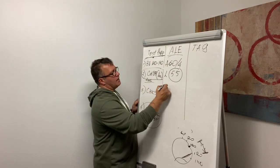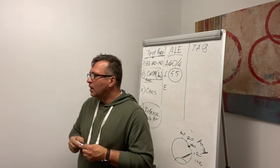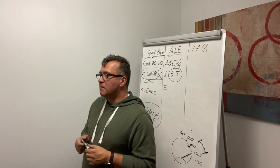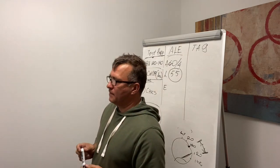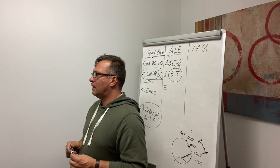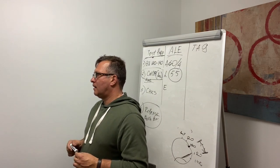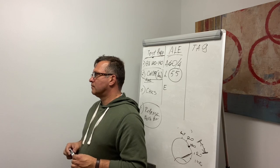Okay, E. Emergency brake what? Emergency brake test. Brake system test. You're testing the brake system. Yes, sir. So the buzzer comes on when the low air pressure comes to around 55.